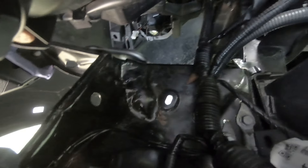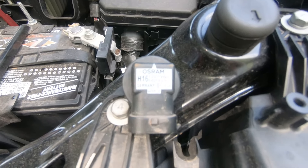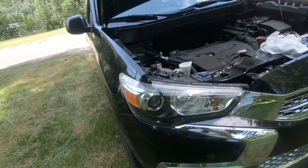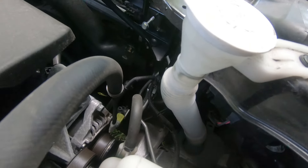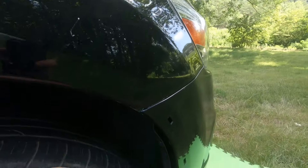As you can see, you can see the fog light from here. By the way, this is the fog light bulb type H16. The hardest part is on the passenger side because there is a window washer fluid tank there and you cannot reach it.